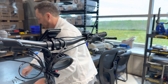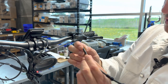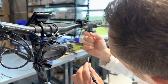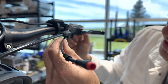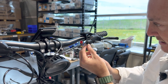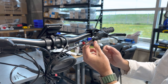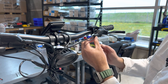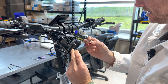So that's a faulty sensor. Now we're going to put the replacement sensor in. You're going to notice that there's a notch on the sensor. We're going to want to make sure it goes into the notch on top so it matches — notch goes up. We've got that in, and then we start screwing lightly. Before we put the bolt back in, we're going to test it to see that it's at the right position. I'm going to reconnect the wire.